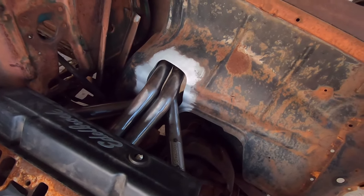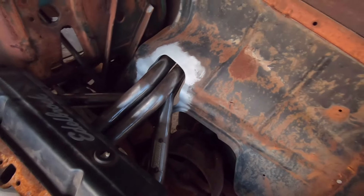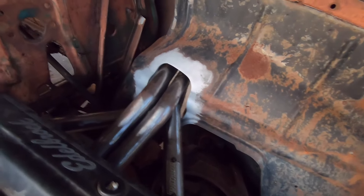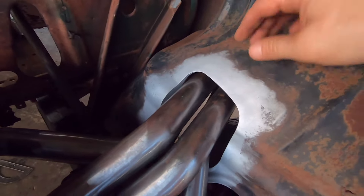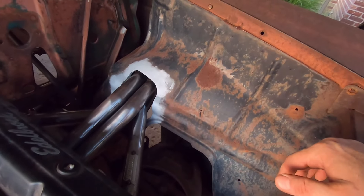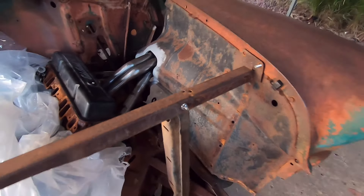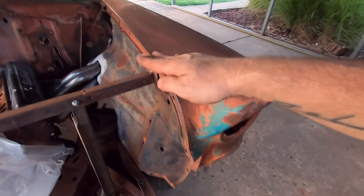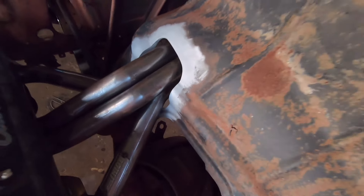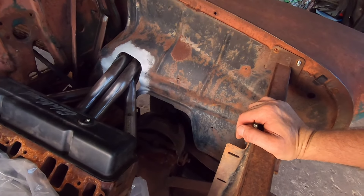All right, I've got it - it's almost done. I've got to go to the back side and even out the flange depth because some of it's wider than the other. So I've got to thin it out a little bit in places and then I'll be done with it. It's actually got a flange on it so it looks really nice. I kind of rolled the edge just a little bit - it needs a little more, it's a little too sharp. I want to radius that pretty good. When the front clip is on it, the core support's on it and this fender is heavy at the front and it's pushing down. So when this fender goes up, it gives it the clearance it's supposed to have.